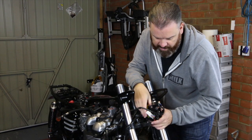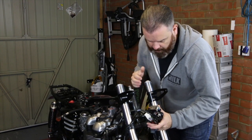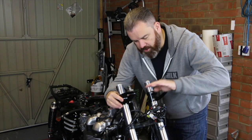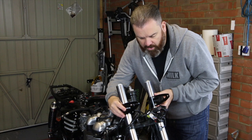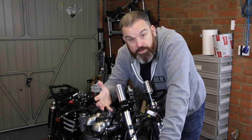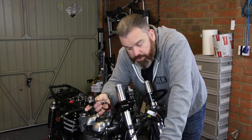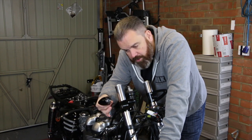We've got a pretty naked looking front end of the bike — it looks a mess. But obviously all of this wiring is going to sit back in the headlight bucket. Now the rectifier has gone and we're going to be using that lay flat gauge bracket, so we can actually move the headlight a little bit lower down. When it comes to the indicators, I've chosen — as this is a Motone project bike — to use the black Motone indicators.